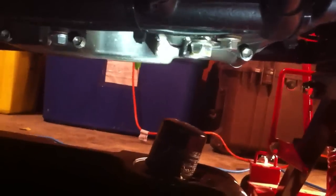We'll come around to the side of the bike. Underneath here, you've got a 17mm that you just have to undo here. Hopefully you can see me point at that. Undo that, your oil is going to start falling into your drip pan. Have your drip pan ready.